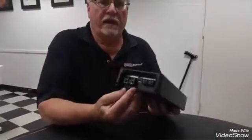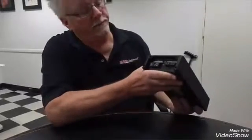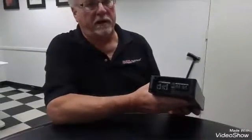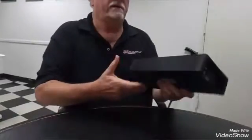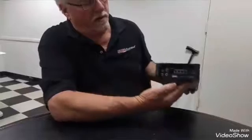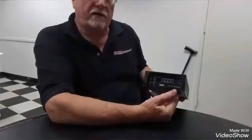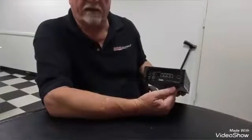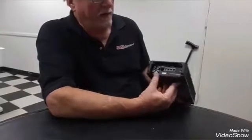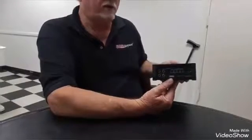Your end panel here is a four gauge input for your power and ground wire, plus your turn-on lead. And of course your output here — you can either run to a single subwoofer or you can run to two subwoofers. The other side has your gain adjustments, low-pass filter, phase selector — 180 degrees either way. If you find out after the install you need to change the phasing of your subs, you can do that at the amplifier instead of having to rewire your speaker. There's also an input and an output so you can daisy chain your signal together and run multiple amplifiers.